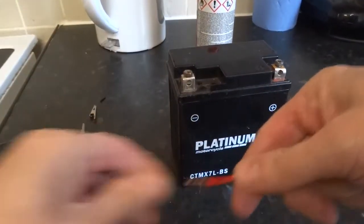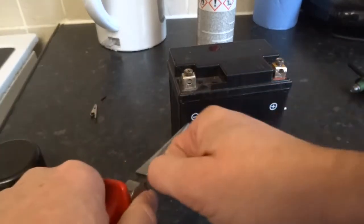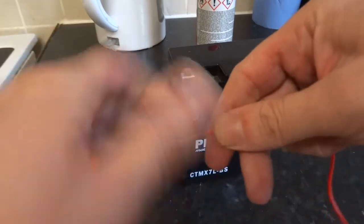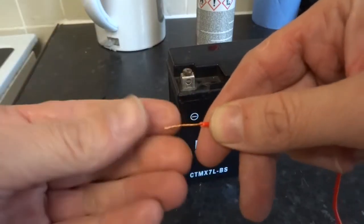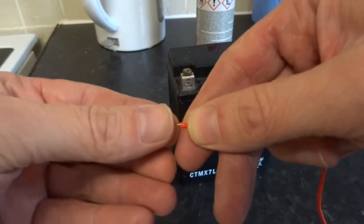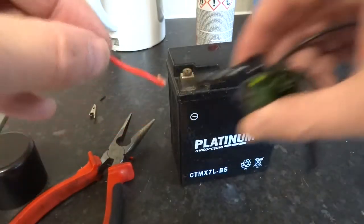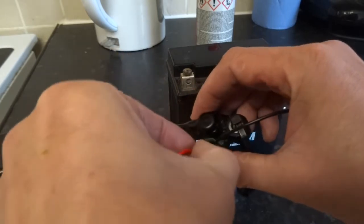To make the wire, if you haven't got a piece of an old loom — obviously you're better to use an old injector connector — what I'll do is fold them back a little bit at a time, and then fold it back on the wire on the insulation. That way it makes it nice and thick, and then you can shove the wire in and push it down alongside the terminal.